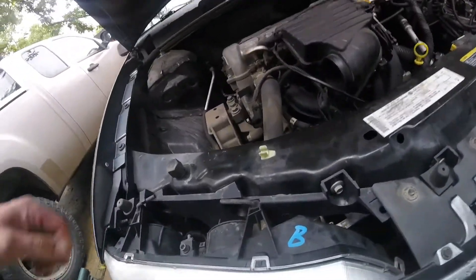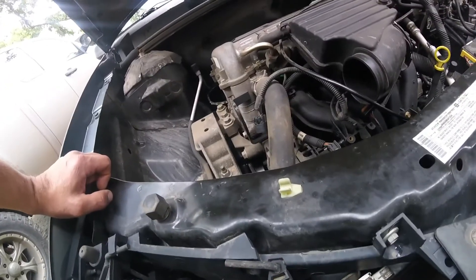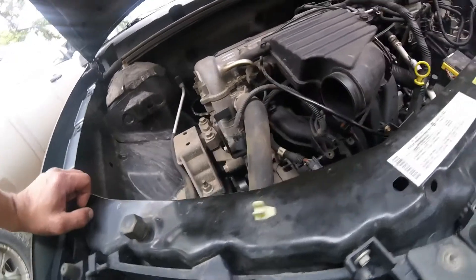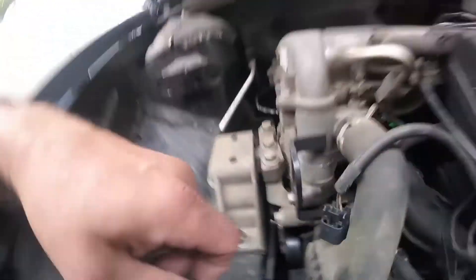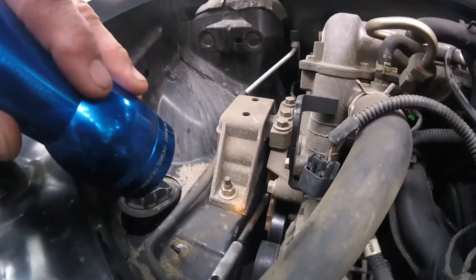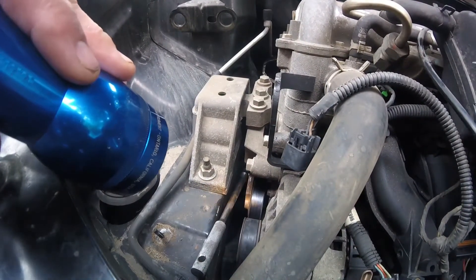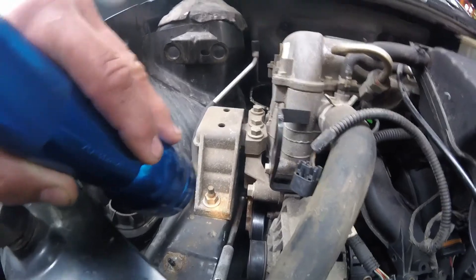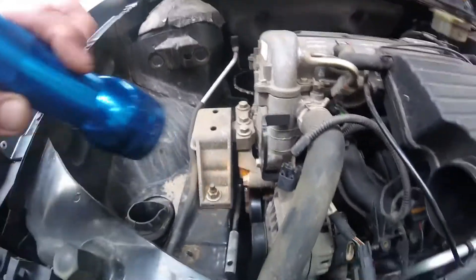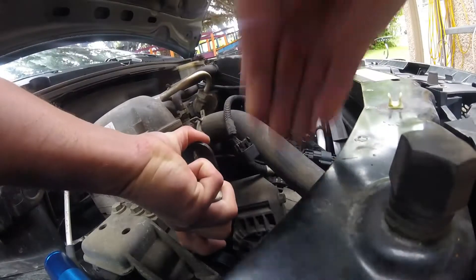I couldn't really find a lot online, so this is why I'm doing the video. It'll mostly cover reinstalling the alternator and putting everything back together since I already tore into it. If you don't know where to put your 3/8 flex bar for the tensioner pulley, you're completely out of luck. It just takes the square socket, and once it's in there you can take the tension off pretty easily to get the belt off.